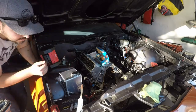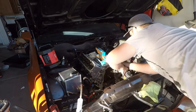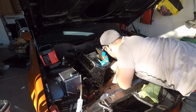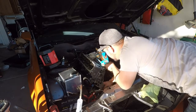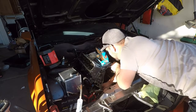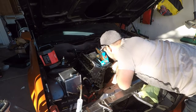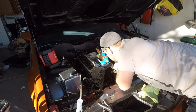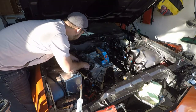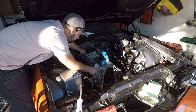We're now going to crank our engine over a couple rotations. Wait for your rocker arm to move. All right. That was the intake compressing opening. Here's the exhaust. It's open and compressed. Just do it one more time. Now we're going to take our cylinder head off. We're going to go ahead and pull our head off now. Pull straight up, try not to scratch the bottom.